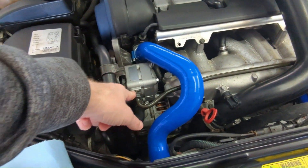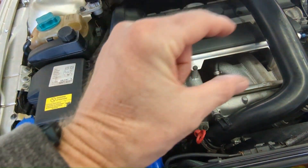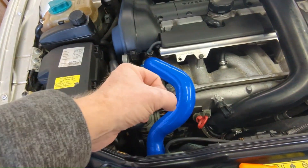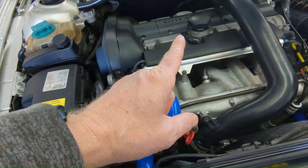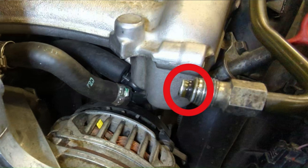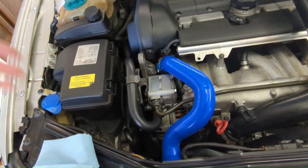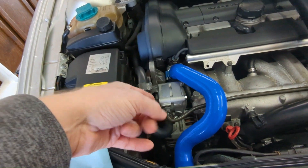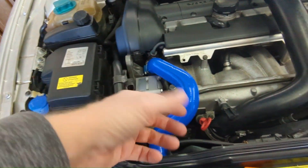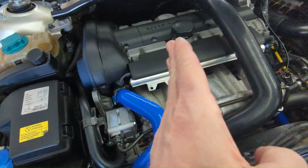I think it was just not completely pressing on that O-ring. The O-ring I did replace — the one that came out was black and shredded to bits, just a little itty bitty outline of a ring still in there. I reached in and pulled it out. On the tip of the hydraulic coupling, there was a little dark area that looked like a little quarter-pipe ring around the ridge. First I thought it was just some residue or grit, but it turns out that was actually the old ring — it had completely reshaped. I figured that out by looking at some Google images. I pried that thing off and it split in half and came off, leaving just a 90-degree angle to the tip.